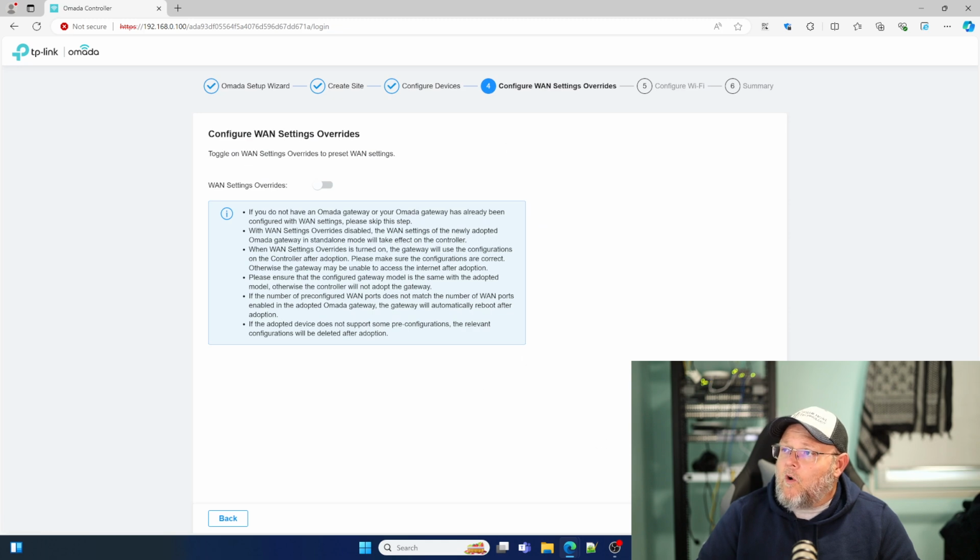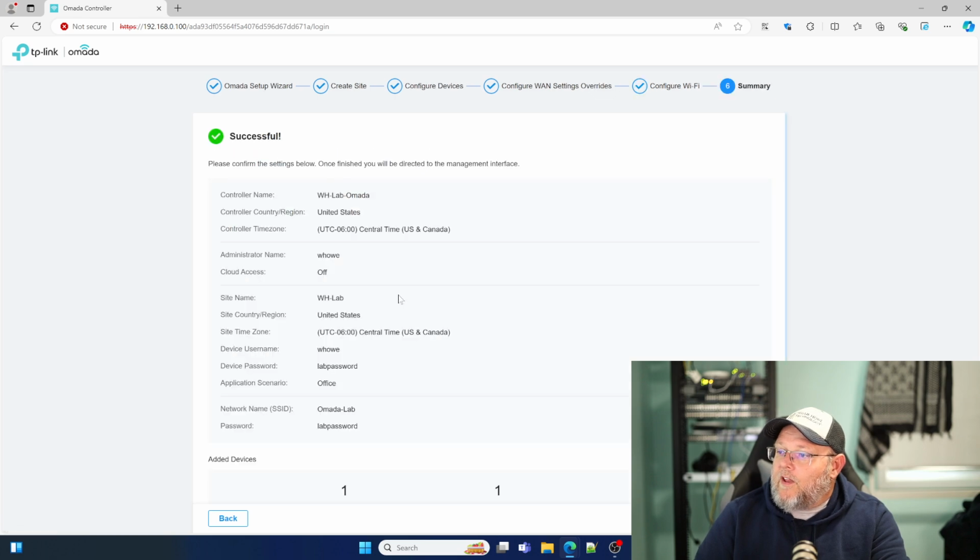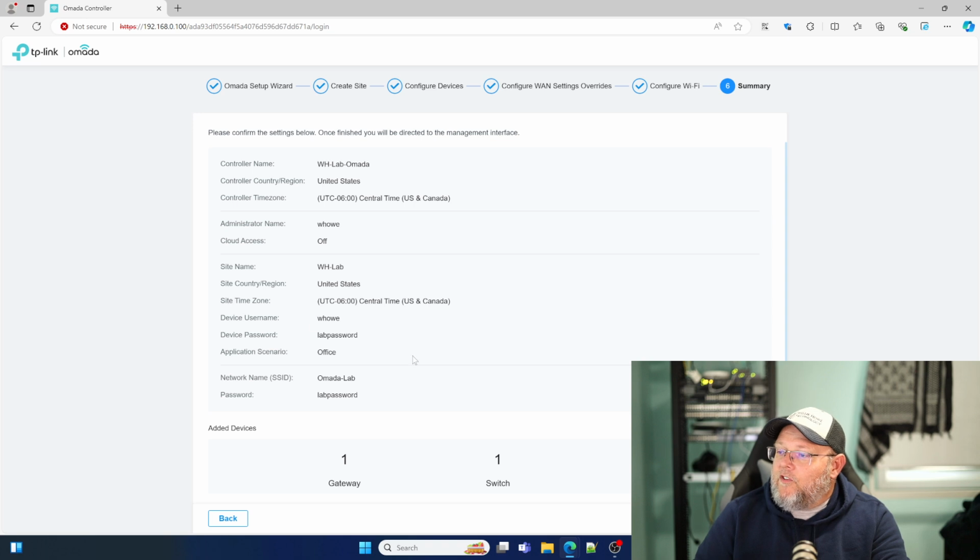I am not going to override anything on the WAN, so we'll go next there. For Wi-Fi, I'm just going to say Omada Lab, and you guessed it, lab password. We'll create guest here in a minute. And so now we've got this overview of everything that we've got. So we're going to go ahead and click finish.